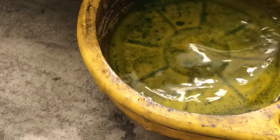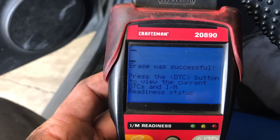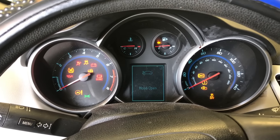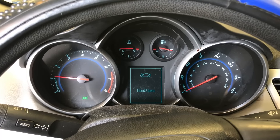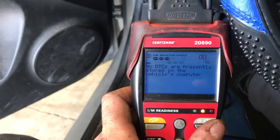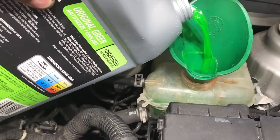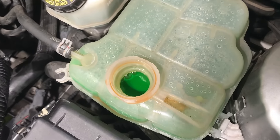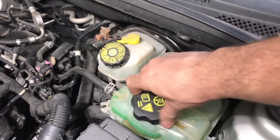Remove the drain pan from underneath the vehicle and dispose of the coolant properly. Turn the ignition on, and if you have a scan tool, go ahead and clear the code. Then start the car and make sure there are no warning lights. Check for codes and make sure no codes have reset. After the engine has run for a few minutes, top the coolant off again after it's purged all the air from the system — you may see a few bubbles come up, which is normal. Reinstall the radiator surge tank cap or coolant reservoir cap.